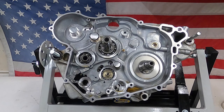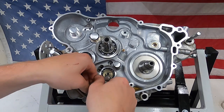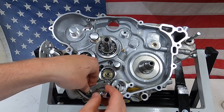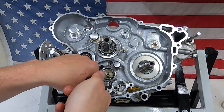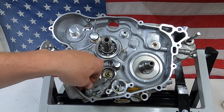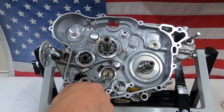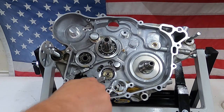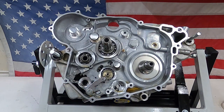The first part of the shifter assembly, I'm going to install the locking lever. This is going to be an M5 bolt, and it's going to be torqued to 4.4 foot-pounds. It's important when you install this that you make sure that the spring is up on this side of the tab. It is important that you use blue Loctite on that and make sure it doesn't come out.